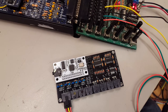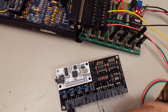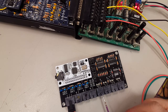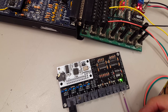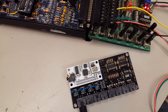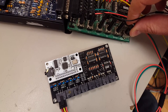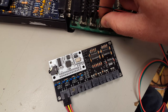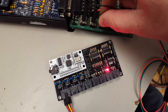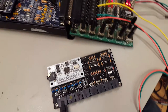Got my tiny IOX breakout board finished up. We have six digital inputs and two one-amp outputs. One's set up for shift light right now. The other one is set up with a TPS input over 50%, and we also have four analog-to-digital inputs.